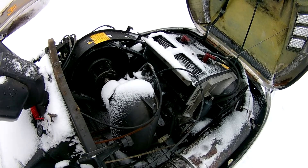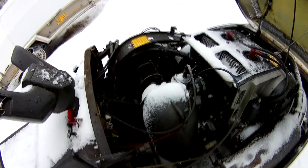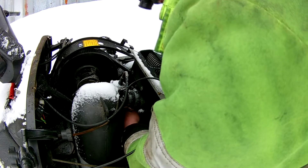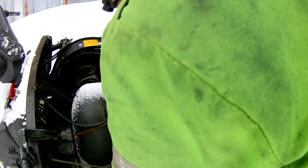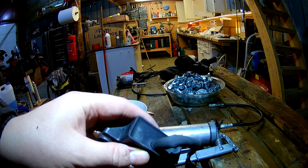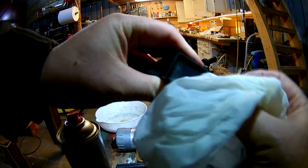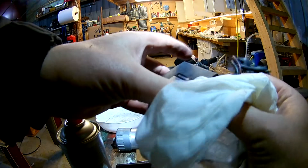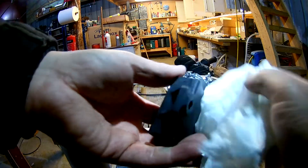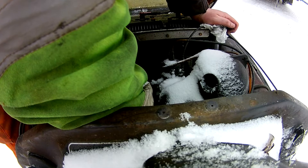Next: the old snowmobile. It's actually running quite well, but the fuel clutch thing doesn't work super well — good enough to get from point A to point B. The problem is it's left us stranded two times with no spark. We suspected something electrical, and the CDI box has a crack at the bottom, which doesn't seem uncommon after some googling. We took it in and let it dry for a few days above the wood stove.